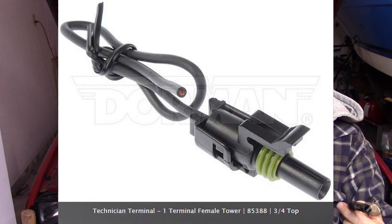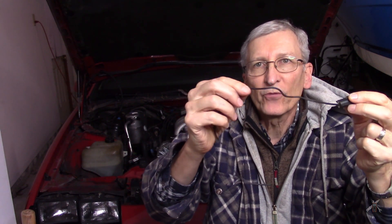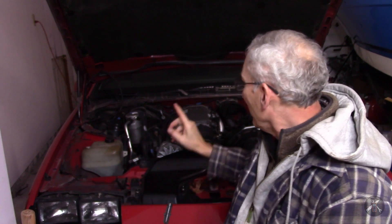Here's the Dorman. Here's connector number one, and here's connector number two. With those two connectors, they come with pigtails on them. You splice the two pigtails together. In my case, I soldered the wire, wrapped it and soldered it, and I put a piece of shrink tubing over it and heat shrunk it on to seal it up. Then I took the plastic piece that came with this one and was able to install it on that extension harness. So you plug the new sensor into the extension harness, and the extension harness goes all the way to the back of the intake manifold to the original connector and clips on.